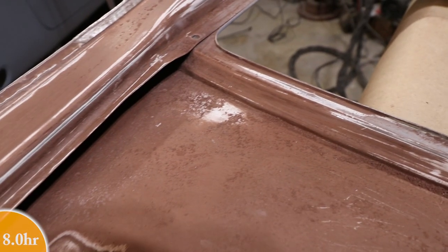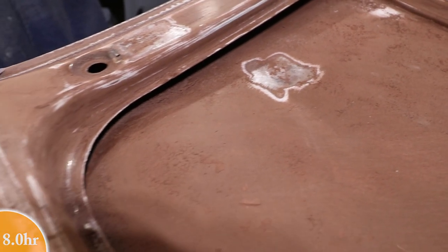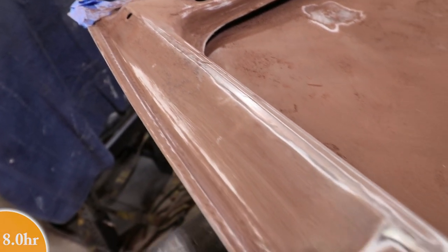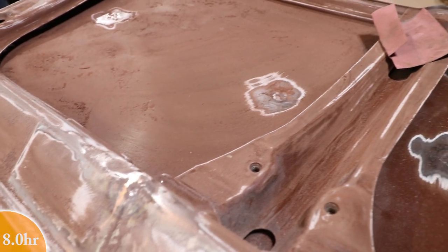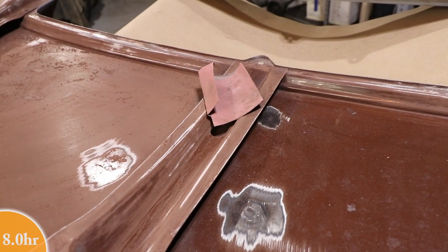This is making me hungry — this looks just like cocoa powder. I'm not going to go all the way down to bare metal on this; the paint is original and in pretty good shape. So I'm just roughing it up with 180, getting some of the blemishes out of it, and then I'm going to put epoxy primer over the whole thing — that'll take care of the bare metal.